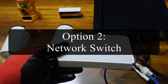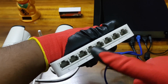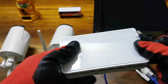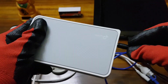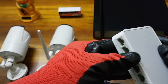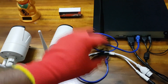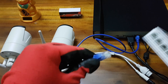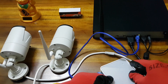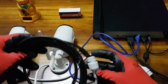The second method is using a network switch. We will power on the switch and connect the devices to its ethernet ports. This network switch model connects to a modem from port 8. Since we are not using a modem, we will connect the NVR to port 8. The other devices can be connected to the remaining ports.